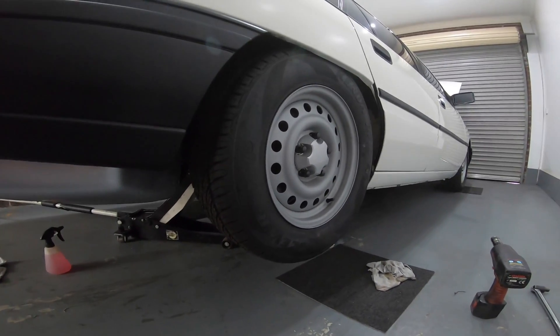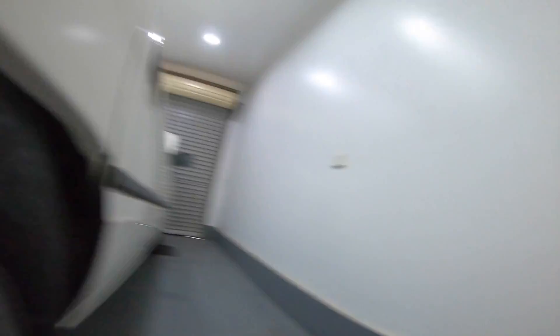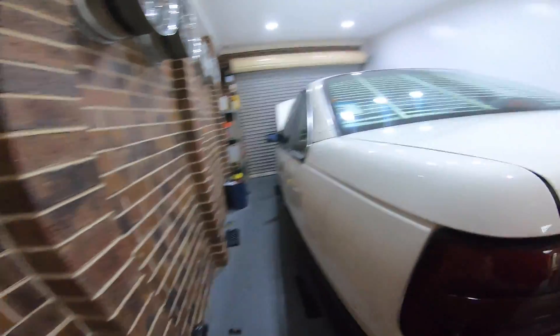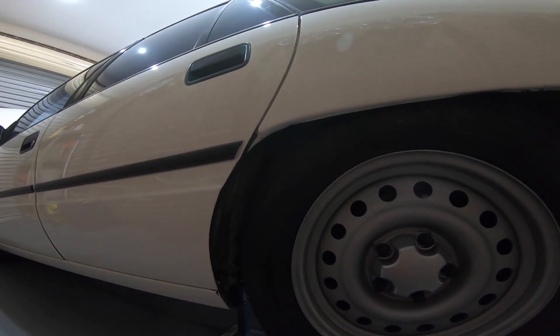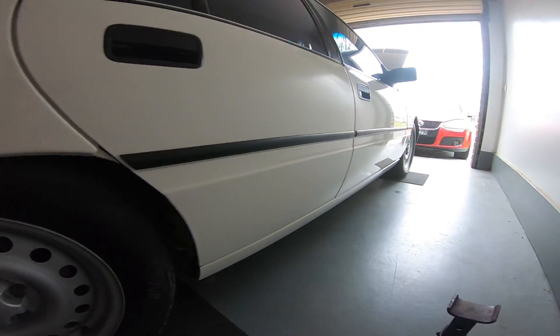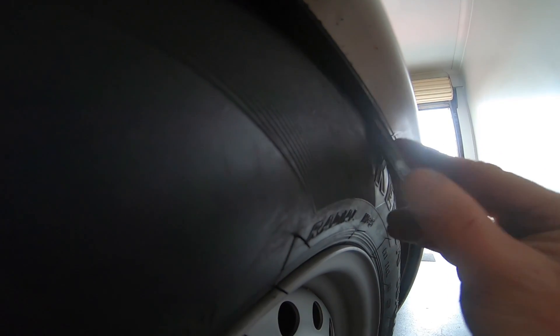These look so much better on the back with a bigger tire, but as I suspected, my license plate just skims through there. The good thing is I can just shave this lip the tiniest bit and it should be all right. Now that I've put the other side on, this one actually has a fair bit of room. Because it has an adjustable panhard rod, I can just lengthen it and it should bring the axle over a little bit. Super, super happy with that — with the panhard rod moved over, this side is now even with the other side. Plenty of room, didn't have to touch the guards.